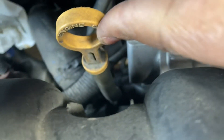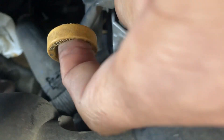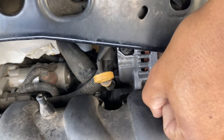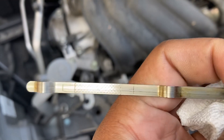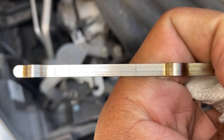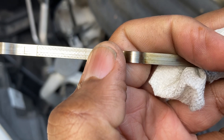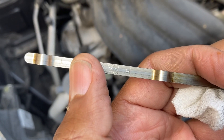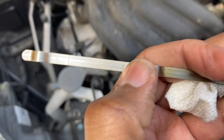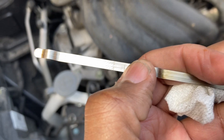And this is your oil dipstick. It's always more than likely gonna be shaped like a circle — that O means for oil. If it's shaped like a T, more than likely that's for your transmission; leave that alone, it's gonna be red. Most cars nowadays don't have transmission dipsticks. So if you're looking at the dipstick clean, it's an L and an H. When you put it in there and it comes right to H, that's when it's full — leave it alone, don't do nothing. If it's on the L, you're gonna add about half a quart slowly, then put the dipstick back in and check it. Don't just start dumping the oil in there. What you don't want is too much oil — you want some, but not too much, or you have other problems.